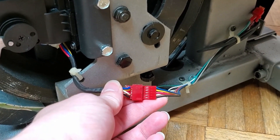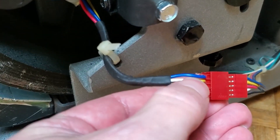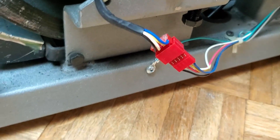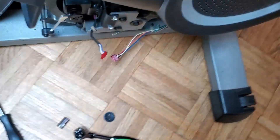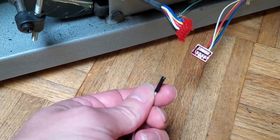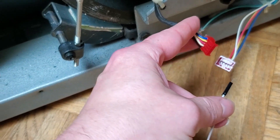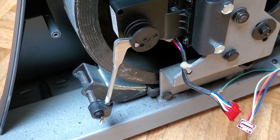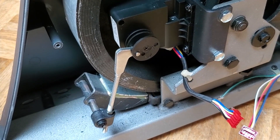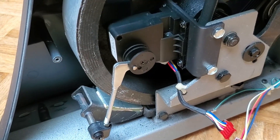The way you can do that is take this plug apart and get access to two pairs of wires — this blue one and this yellow one. You can either try to connect to them there, or if you have a jumper cable — I mean a DuPont connector — you can slide that right into the hole and then use just a pair of AA batteries. It doesn't matter what the polarity is to try and turn the motor. In my unit the motor works just fine, so I can increase and reduce the resistance without any problem. That suggests very strongly that this is not the part you need to replace and the problem is in the console.